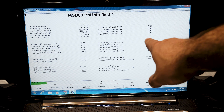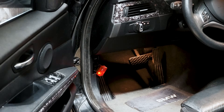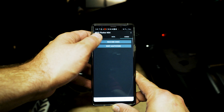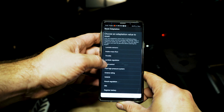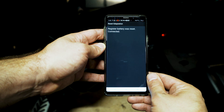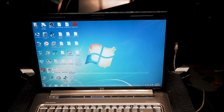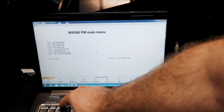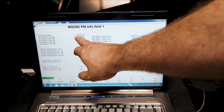If you have one of these K+DCAN cables you can use that, but I'm going to use my MHD wireless adapter. Loading up MHD Flasher — read DME codes — we're connected. Now if I go to reset adaptations, I can register a battery right there. Battery registration was reset — that's as easy as that, if you have a car supported by MHD. We can easily verify that it worked — boom, last battery change at 313,600 kilometers, and that's exactly where I'm at right now.